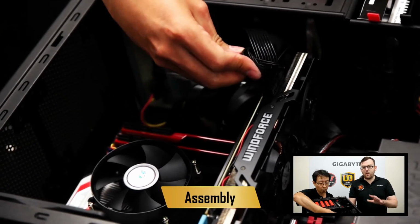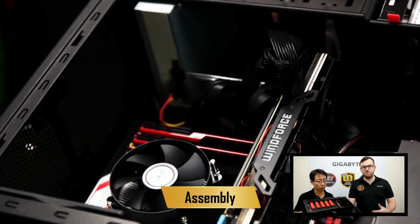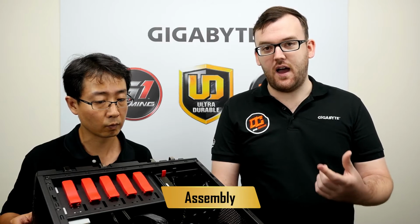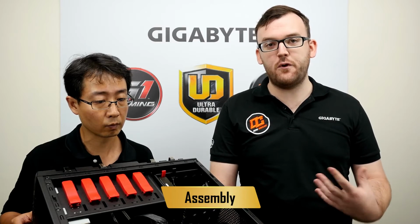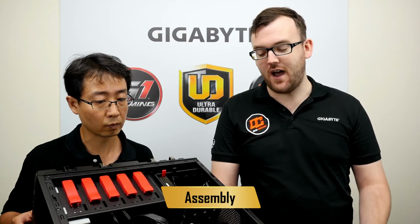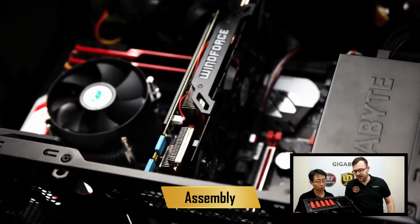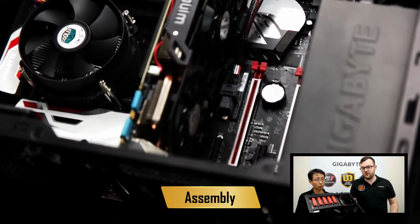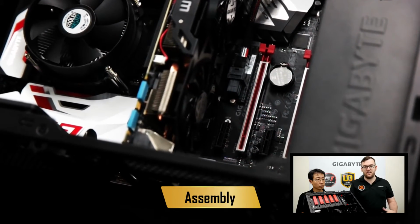One more thing, our motherboards have a PCI Express metal shield on them. That way you won't damage the actual slot itself with heavier cards, because with wear and tear and constant movement, without that shielding, there's a chance that you might damage the actual slot. So if you look carefully on the motherboard, the slots have a metal shield around them, and that is our exclusive shield, and it does a great job at protecting these cards to make sure that you won't damage your board with them.